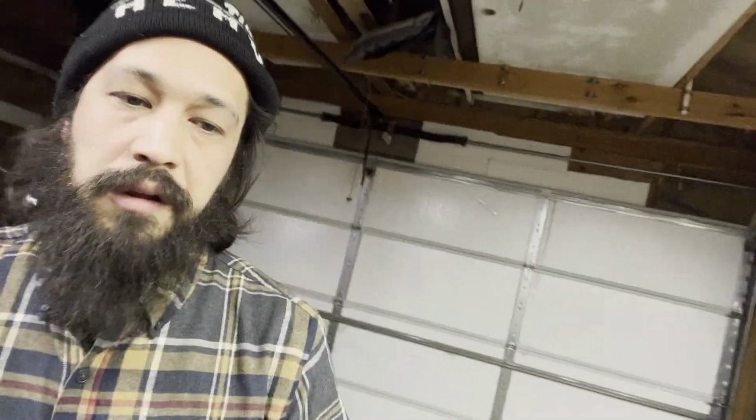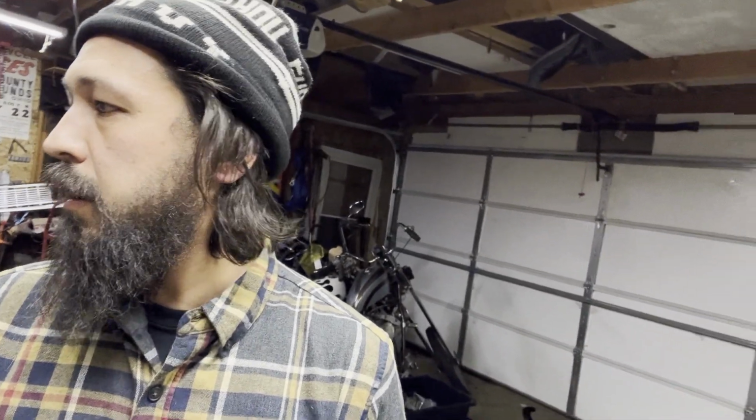still sitting in the frame with the axle and the swing arm on that Arlen Ness digger project that I took on. That's gonna sit forever until I get enough parts to build that one. So basically what I gotta do is run upstairs at the shop, take apart this wheel, pull the axle and the wheel and the brake, which I needed to do anyway since I don't have a brake on that wheel. And I will basically take the 16 wheel, swap all of the internals from the 16 over to this one, and mount up the drum brake and all the other required parts that I have on that bike.